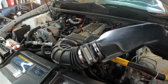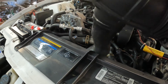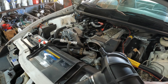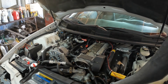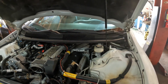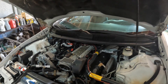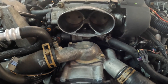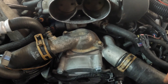We are going to be changing that. First thing you need to do is just take the air cleaner and air box off of it, just because you have to get down to the front. The OptiSpark distributor lives behind the water pump actually.